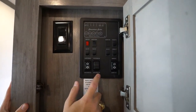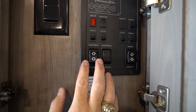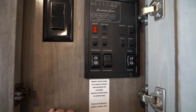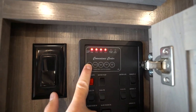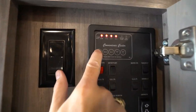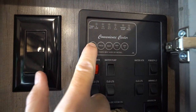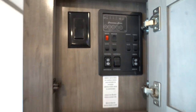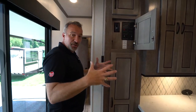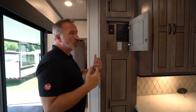With your convenience center, you can cut on your tank heater, your water pump, the lights, run out the slide rooms, run out the awnings, as well as check the battery, the fresh tank, the black and gray tanks. If you check your battery and you're plugged into shore power but it's not showing full, go check the post, make sure everything's on and connected. Get a surge protector — or even better, one of those Hughes surge protectors, those big ones that can adjust the amperage — because you're going to need at least two-thirds or 11.8 volts to run the slides out.